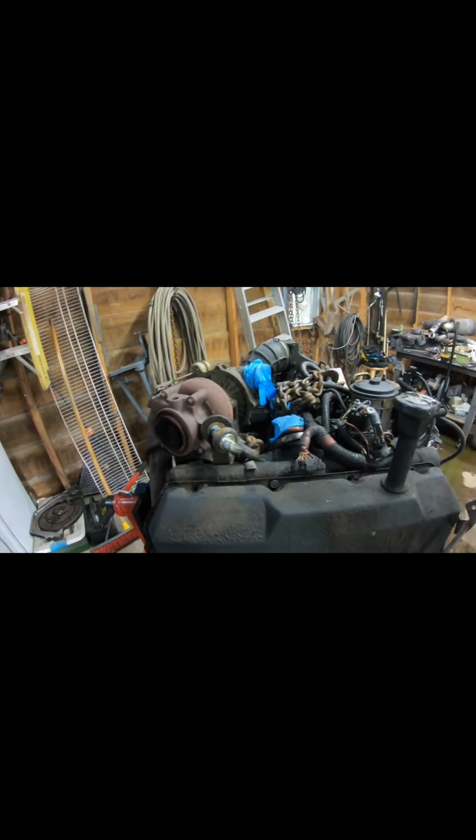I bought this about a year ago when I had problems with my red truck, with my spare engine, with the injector cups, when the diesel fuel got all inside the coolant. I was going to try using that to clean out the inside, and after reading the do's and don'ts, I decided not to. I wound up flushing it with, I think, Dawn dish detergent, and many cycles of cleaning to get the diesel out of that. So anyway, that's what I used.